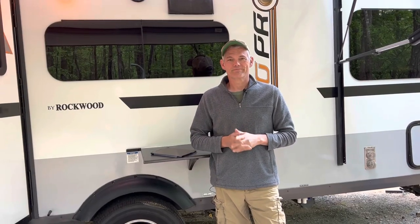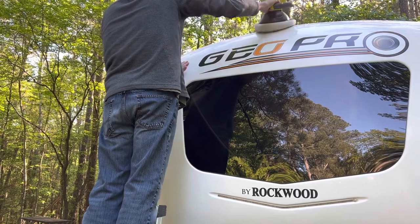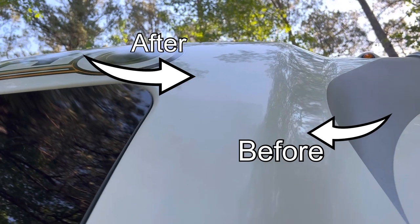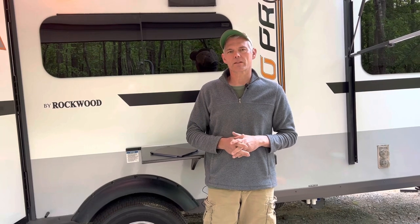Time for question and answer. About how long did it take us working primarily as a team? I want to say it took about four and a half to five hours. So why did we use the buffer on the front cap? The front cap is fiberglass and it's exposed to a lot of UV sunlight. It was heavily oxidized, really chalking bad and not looking good. So I used the buffer to lift that out quicker — it would have taken forever by hand. The buffer really sped that up.